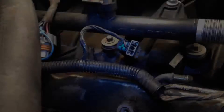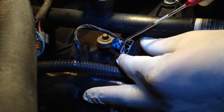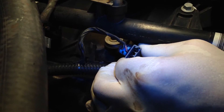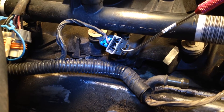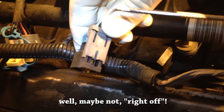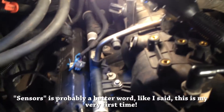That hose was very easy to get out, from the very back of the valve cover. It's got oil on it — so PCV, something like that. In order to get this clip off, you're supposed to just press and slide, but it's not that easy. I found that if you jam this in here and press them both at the same time, it comes out. Once you get the gray clip up, it's just a matter of pressing with your thumb right here, and it comes right off. Fuel injector connectors are off — move those aside.